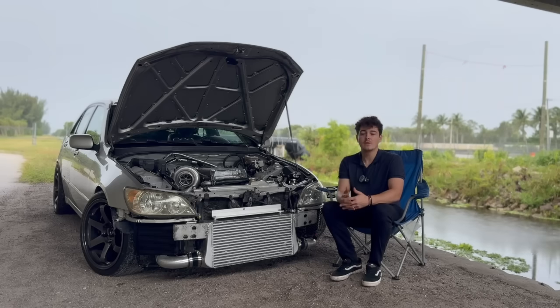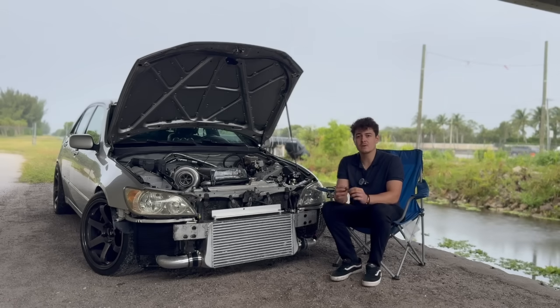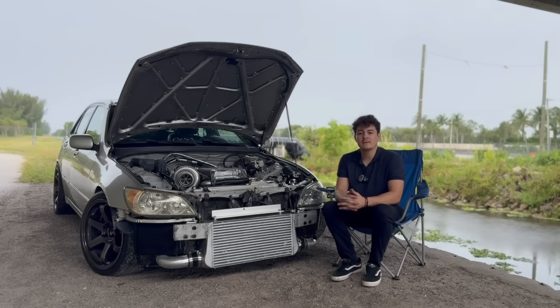With the all-wheel drive imported parts, you're pretty much guessing. Those cars have performed okay, but they've lost some steering capacity — they can't really make full U-turns — and parts aren't available. My goal was an affordable, serviceable kit, something that's OEM-plus: as factory-feeling as possible but with performance and safety benefits. Everything is laser cut, so it's as precise as it can be. What I'm currently running in this car is a 4L80E — basically a truck transmission — with an NP241 transfer case. It's affordable, available, easy to build, DIY-friendly, and proven to hold power.